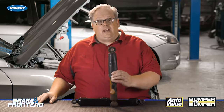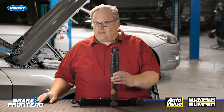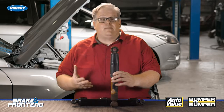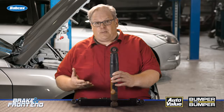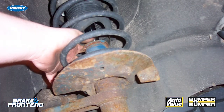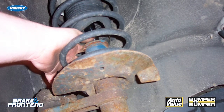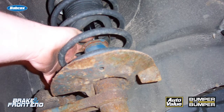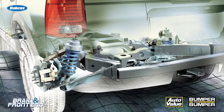The other thing that can wear on a shock absorber is the bushings at the end, and also with a strut, the strut mounts and the isolators of the spring. They'll wear out over time because they're made of a soft material like rubber, and over time they can be damaged by the environment. When that happens, it's like having no shock absorber or strut at all — for close to a quarter of an inch depending on how badly the bushing is worn.